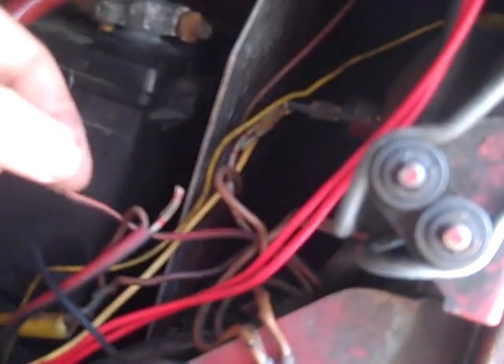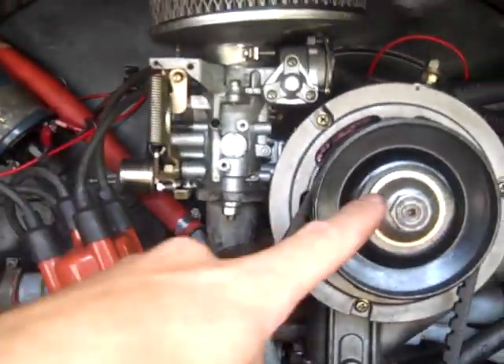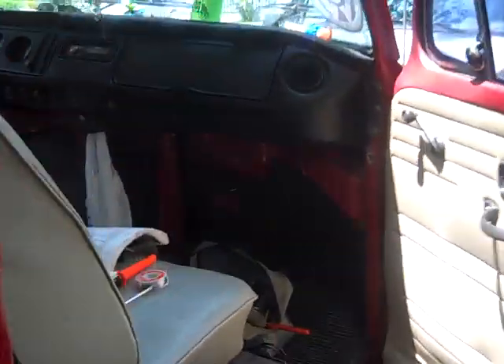There's quick fixes like this. Looking through your wiring diagram, some wires went to side markers I no longer have — they would be live, but unless I'm touching the body and touching that myself I won't have any problems. Here's one where someone just cut the wires off the end of it so it doesn't sit there and short out — you find stuff like this, you should secure it, fix it, and you'll save yourself headaches. With these old cars they've got color coding and each year is probably a little different. When people start making changes — switching over to an alternator, adding an automatic choke, or a different ignition system — everything changes. Something's hot in here, which probably means you've got a grounding problem.